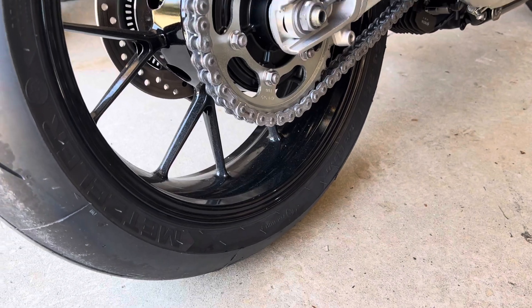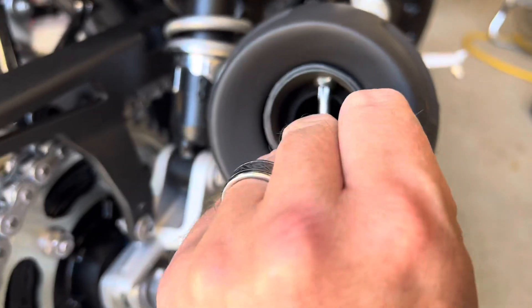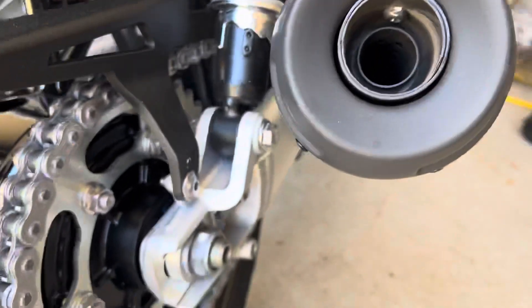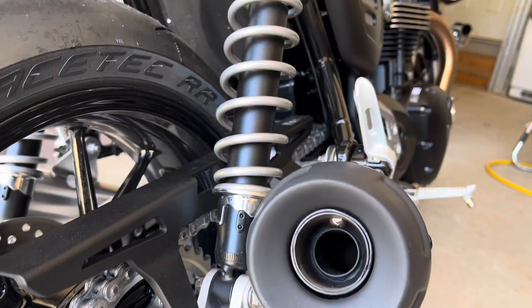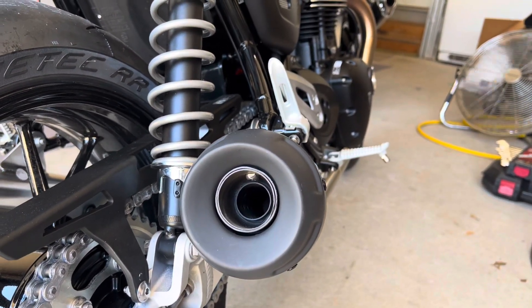Which, if I don't have one — that should be it. Oh, that might be the right one. So we're going to get that up in there nice and tight — I need both hands to do this — and back those screws out, which will allow the DB killers to come out. It'll be a nice straight-through baffle, so it'll look stock but sound better.